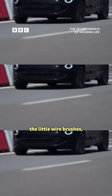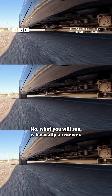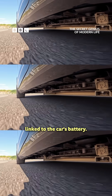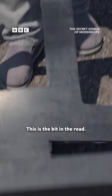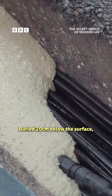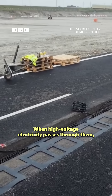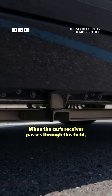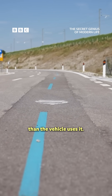But those toy cars have got little wire brushes that hang down from underneath. If I turn this car upside down, will I see the same thing? No. What you will see is basically a receiver — a 40-centimetre-wide electromagnetic coil linked to the car's battery. Another coil in the road transfers power to the car. This is the coil segment — super simple, basically rubber with copper in it. Buried 20 centimetres below the surface, the coil segments are linked together in a row. When high-voltage electricity passes through them, it creates an invisible magnetic field. When the car's receiver passes through this field, it converts it back into electricity, charging the battery quicker than the vehicle uses it.